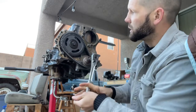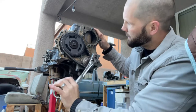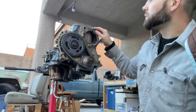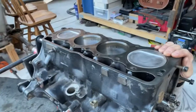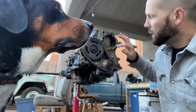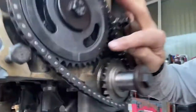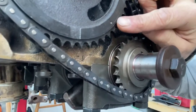There are little timing marks on here. What you do is turn the engine and line up the timing marks. First of all, cylinder number one must be at top dead center — which is this one right here. Then you have to find your two timing marks on each of the sprockets, which is right there.